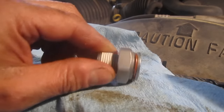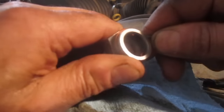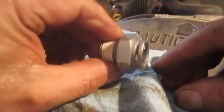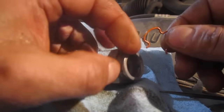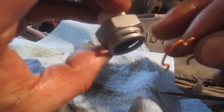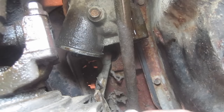This is a good opportunity to show you the grooves and how the clip sits in. You've got grooves here, and basically each one of these ears — the top and the two sides — sits in one of the grooves. With this in place up under the vehicle and threaded in, you're essentially going to need to find a groove to set the top in, and then the two sides will pop in place. We're just going to try to finger-thread them in, top one first — don't cross-thread it — and if you mess up the Teflon tape, you want to rewrap it or put some thread goop on there.